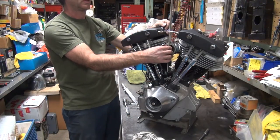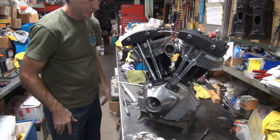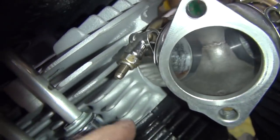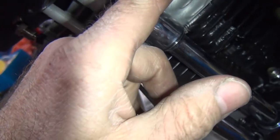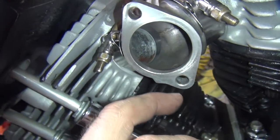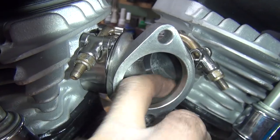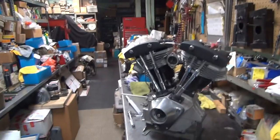There's nourishment in that drawer — chips. I've gone this long without eating, why worry about it now. So I've got the manifold halfway lined up — very tight squeeze on everything. Clamps are going to get tight up under there. This one's jamming in already, this one needs to be rotated forward — it's already bottomed out, so I need to loosen up and slide it down. The alignment looks pretty good though. That's one good thing about these metal-on-metal clamps — they line up pretty nicely. If I had time to cut this manifold I could make this transition a little better. It's short on time, it'll just have to work like a stock bike.